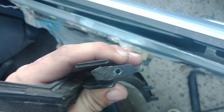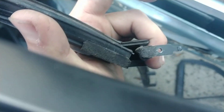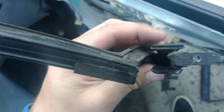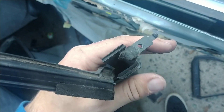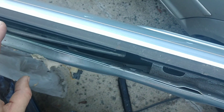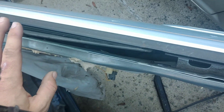You're going to want to pull this forward on the door as you peel the window channel out of it and the door. Try to be careful — the little ridges that hold it in can be ripped, especially on an older vehicle. As you pull it back, get it disconnected so there's a little bit sticking out of the bar and out of the door. Then pull it up out of the door, watching out for the hook on the bottom — it will most likely get caught there. Wiggle it around the window carefully, as the window is now unsupported on one side and can be pressed against things inside the door and possibly crack or even explode the glass.